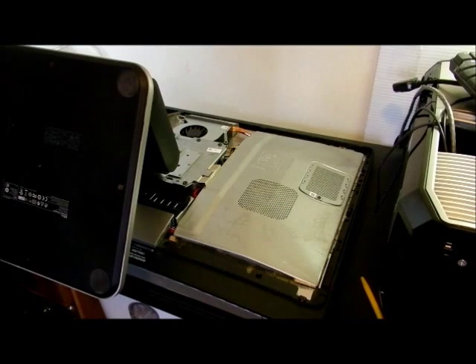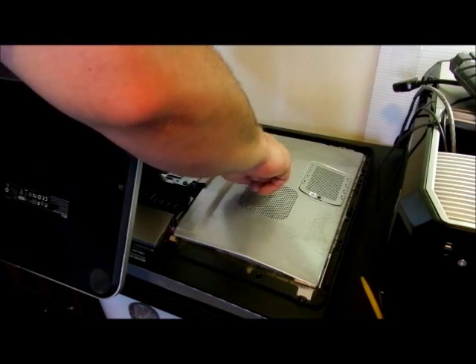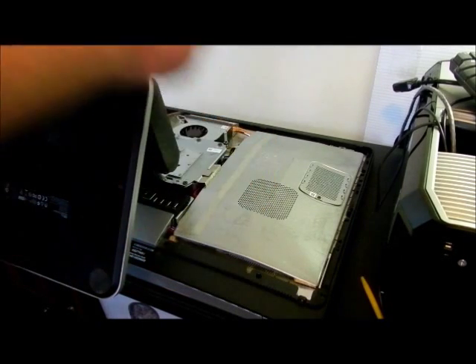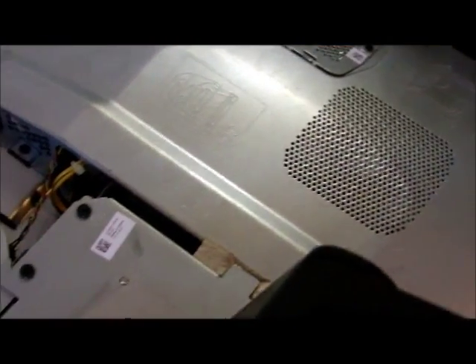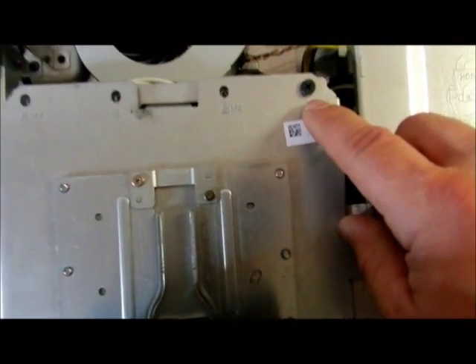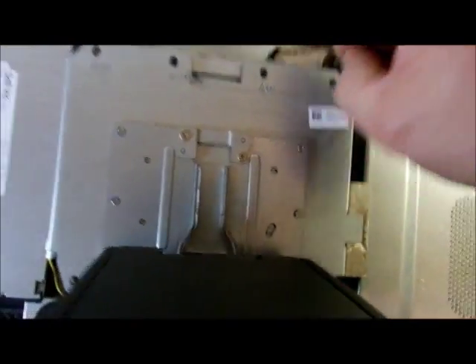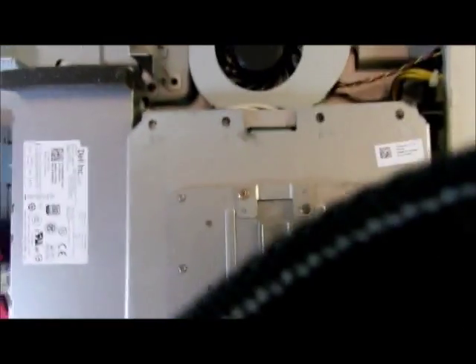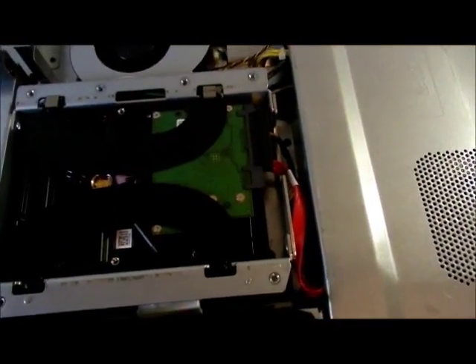What I'm looking for is the hard drive. It says right here where the hard drive is — there are instructions here. It says hard drive 1 and it's pointing right here. Now there are six black screws all the way around — the big black screws. Don't take any of these off; you don't need to. You take these smaller ones off and set them aside in a safe place. There's a clip right here — you're going to lift the back leg up, forward and up, and take out that clip. Right there is the hard drive. Remember, it's upside down.